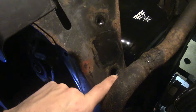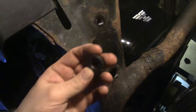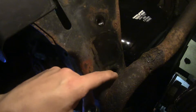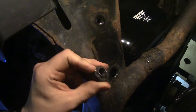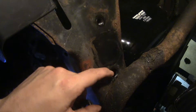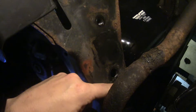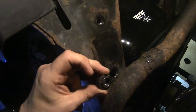This hole is where I had to cut out the bolt for the sway bar bracket. This nut was inside the frame — it's supposed to be mounted there in such a way that it doesn't come loose, but it did come loose. So what I need to do is cut some slots on either side of this hole so that I can insert that nut, and then there will be an opening that I can weld through to hold that nut in place.